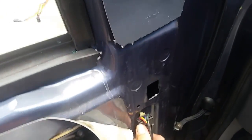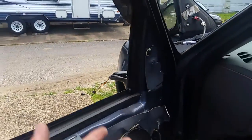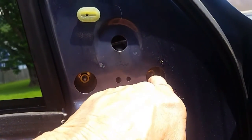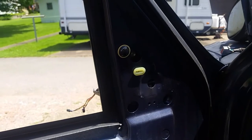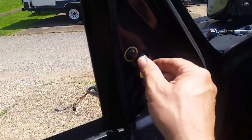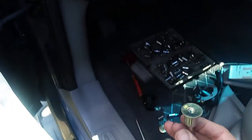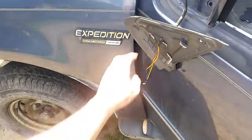So all we've got to do now is pull some of this stuff back here. Here is this plug, and I don't think the mirror plug is going to be the same. But like I said, we'll get another mirror later — but we need something on here now to be able to drive it. At least you have some idea how to get in here and take this mirror out in case you have to change yours. Now we've got to get in here and take out these three nuts on the studs — I believe they are 10 millimeters. I've already taken two of the three out, and here comes the last one. These actually are 7/16ths, but I believe also a 13 millimeter socket will work. And there's all three of them sitting there. Now this mirror will just kind of slide off — pull it off a little bit, and that is it. That's how it comes off.